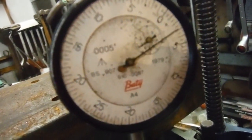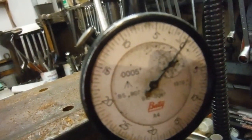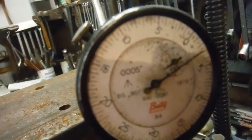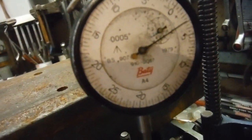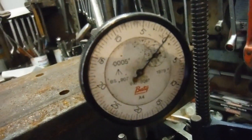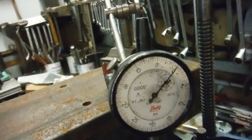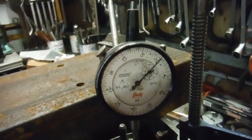It's just on three thousandths of an inch, maybe a whisker under. We're allowed one and a half to three thousandths of an inch, so I'm very happy with that. If I lever harder you can see the whole lot is wiggling about, and if I pull the screwdriver out it doesn't go below zero. No more than three thousandths of an inch — I'm happy with that.